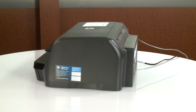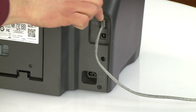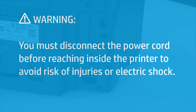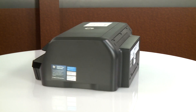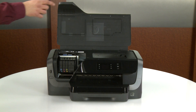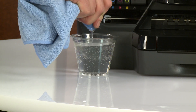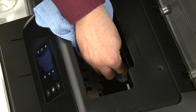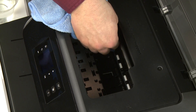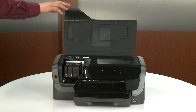Go to the rear. Disconnect the power cord and any other cables. You must disconnect the power cord before reaching inside the printer to avoid risk of injuries or electric shock. Go to the front. Open the ink cartridge access door. Dampen a lint-free cloth with water and squeeze the cloth to remove excess water. Clean all rollers with the cloth to remove any buildup or debris. Rotate each roller as you finish cleaning a section to clean the entire roller. Close the ink cartridge access door.